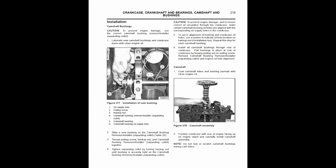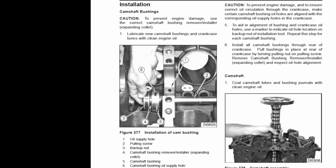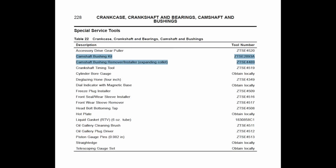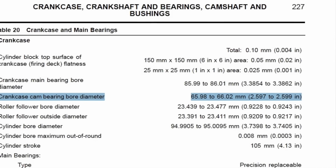Navistar's method for removal and replacement uses pressure rather than impact. Hammer tech was fine for the '60s. There's an engineering reason for not impacting the install. It compresses the ring and alters the diameter. Distortion, even if slight. It may be a picky point, but all the auto manufacturers have moved away from hammering them in to pressing them in. And Navistar has a tool for this. It's an expensive tool. The kit I own doesn't have the 66mm size necessary for these.